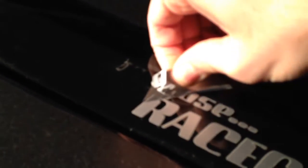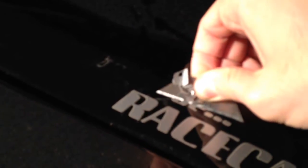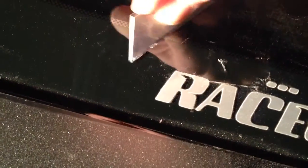First you want to take off the letters like that — just peel those off. Then you have this glue residue that's left, and you don't even need Goo Gone for that. If you just go back over it with your razor blade — and no, you will not scratch your glass — just come down and that's it. Grab a microfiber and just wipe it off.